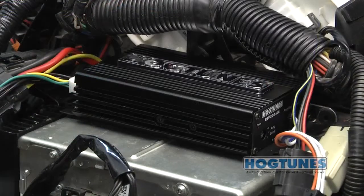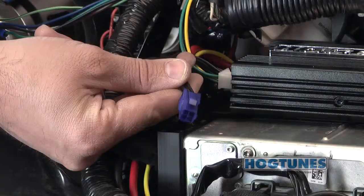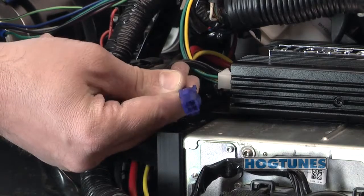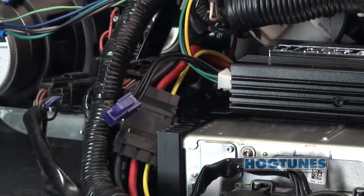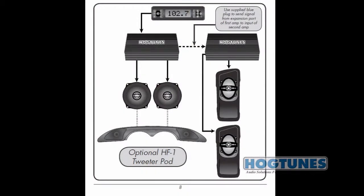This switch allows you to make adjustments to the speakers to tune the bike the way you want between speakers or other amplifiers. There is a leftover four-pin plug on the amp's input harness. This plug carries the radio's built-in power so you can have the amp run one set of speakers and have the radio run a set elsewhere on the bike, such as rears. You can also use this plug to send music to a second amp and create a multi-channel high-power system.